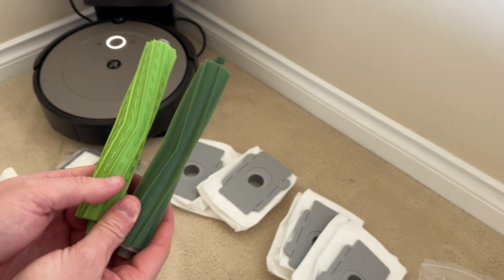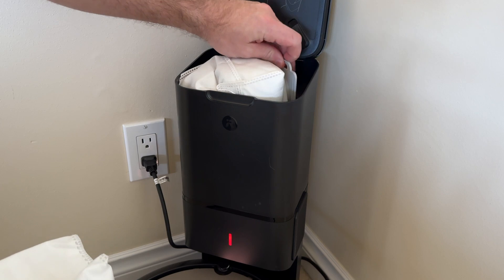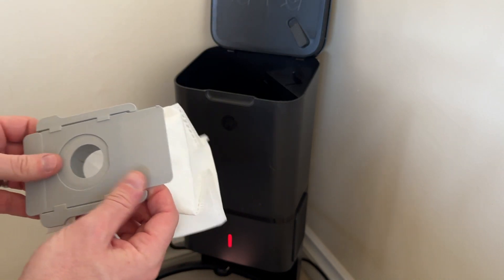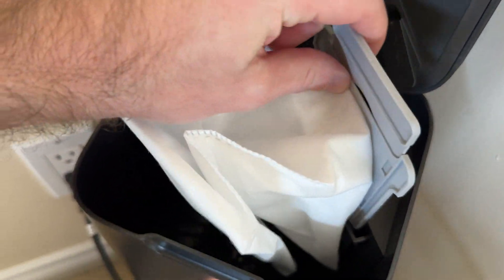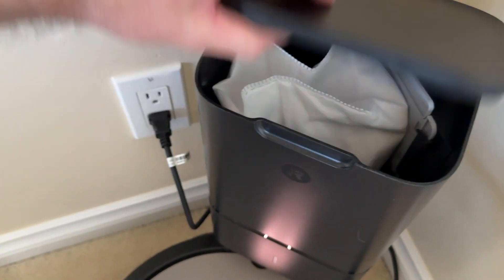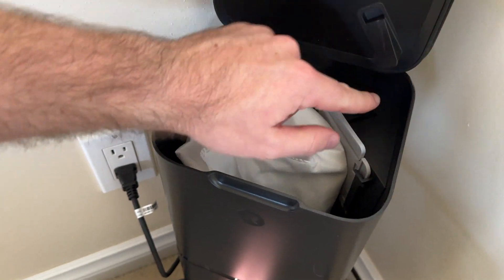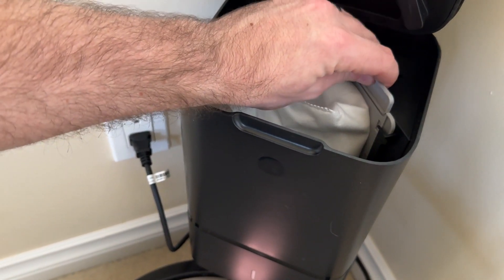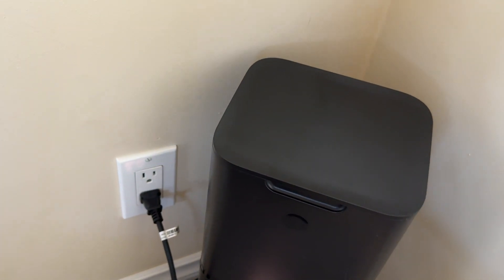First we are going to replace the bag. Many people have done this before, but there's just a little tab — this will go in in this direction, just like this. I'll show you where this goes — right here, it goes directly in just like that. I like to pull out the bag a little bit, and if it's not installed all the way down you'll see how it kind of pops back up. It needs to be installed all the way down for this plunger to seat on it. Once it seats, it's installed correctly — if it's up a little it's not in the right place and it won't shut.